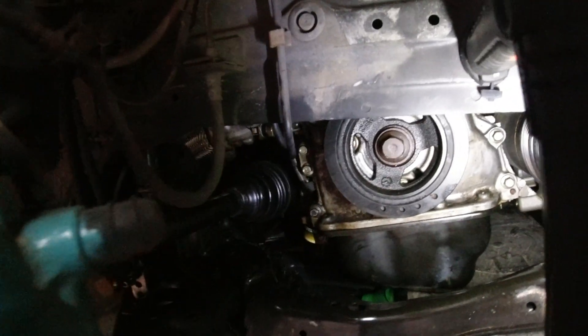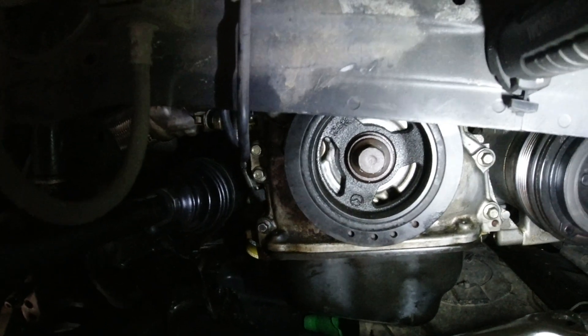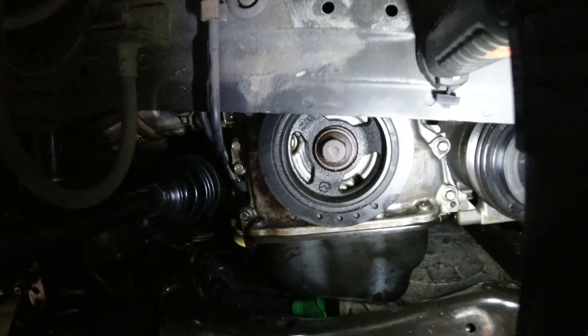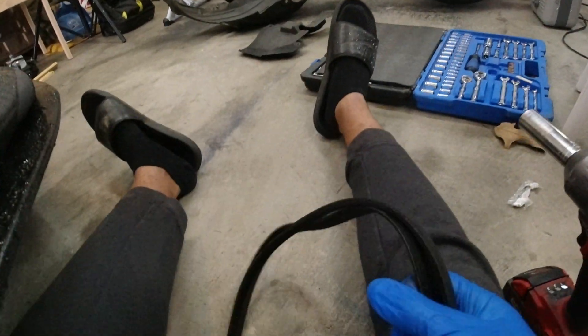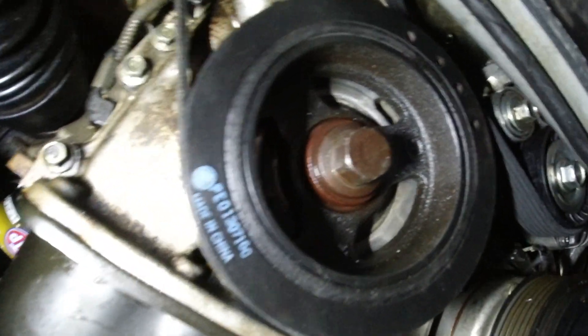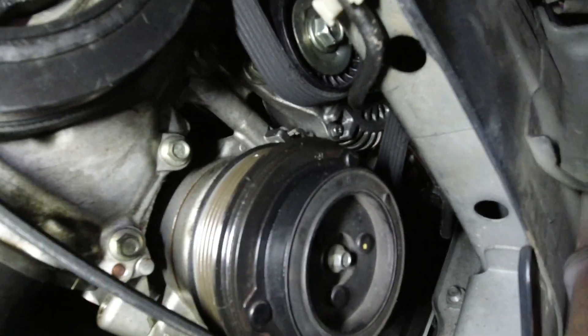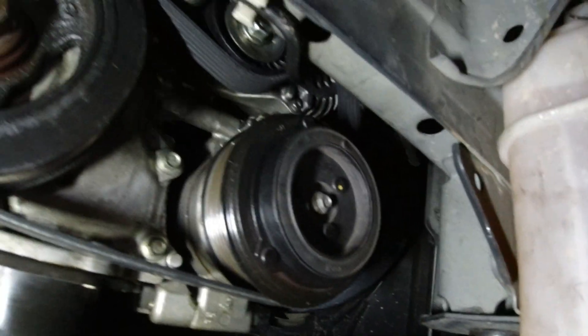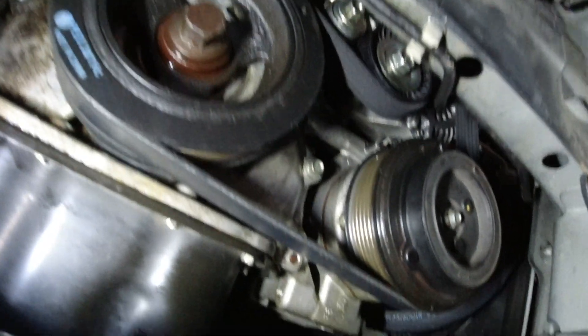Do whatever you do at your own risk, not because I told you to. I'm going to get the belts put back on — you can look at my video on replacing the drive belt, tensioner belt, and tensioner. Everything is back on: water pump belt, stretch-fit belt, serpentine belt — everything is on, alignment is good, everything is in the grooves like it's supposed to be. Now I'm going to start it up, let it run, make sure no oil is slinging everywhere.